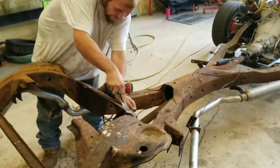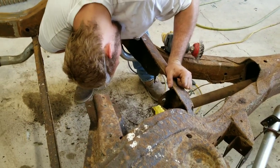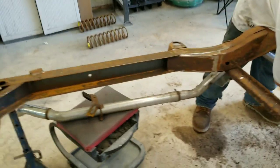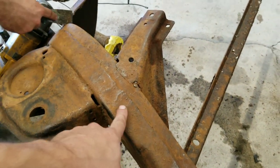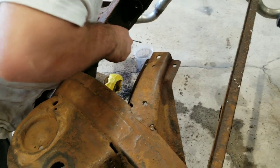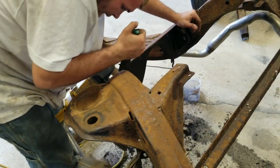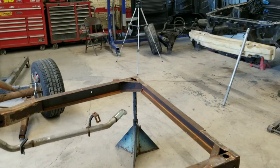He's scraping the loose stuff now that he can't really reach with the wire brush. Then we've got the wire wheel there that cleans it up pretty nice. We've done a small spot over here. All we're trying to do is remove all the scale, corrosion, and loose stuff - anything that'll flake off. That's why we're using POR-15 on this - it's the paint-over-rust stuff. It needs a little bit of rust, and you use the neutralizer with it. If you follow the directions, that stuff comes out as hard as concrete.